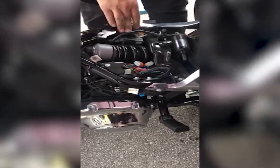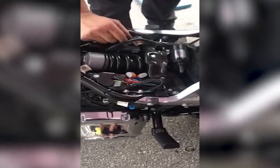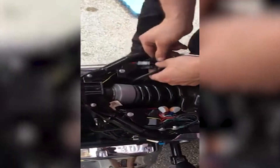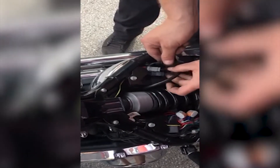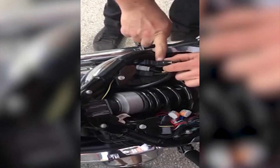This is how to install a smart triple play on an 18 and up soft tail. These are your three rear fender connectors. You have a gray JAE for the right turn, a black JAE for the left turn, and this larger black connector for your center tail light.